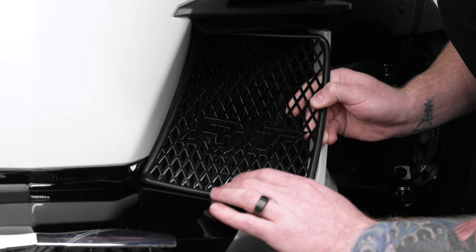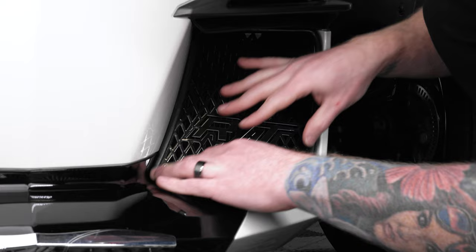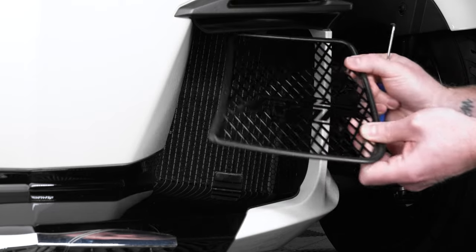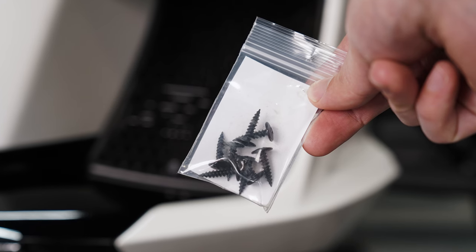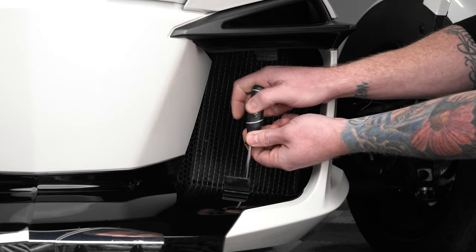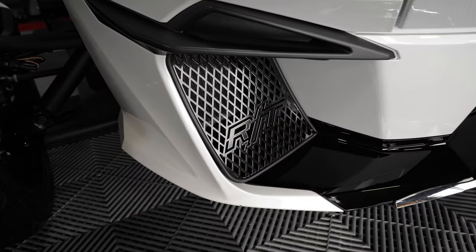Test fit the corresponding grill to ensure proper fitment. If everything looks good, use the included pull tool to remove the grill. The 3M VHB backing tape used to hold the mounting brackets in place is some pretty strong stuff, but a set of screws has been provided by the manufacturer for additional reinforcement. You can mount the screws in place through the two holes in each mounting bracket located here. Once the screws have been installed for both the upper and lower brackets, reinstall your side grill and repeat this installation process for the other side.